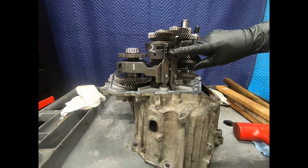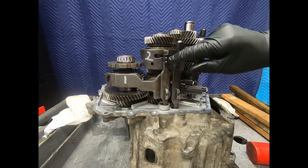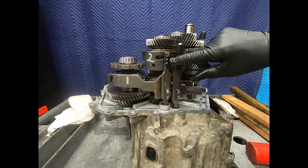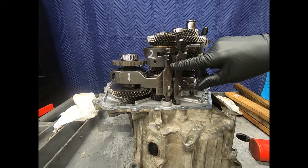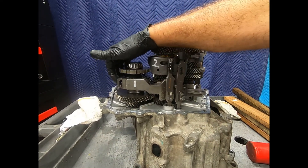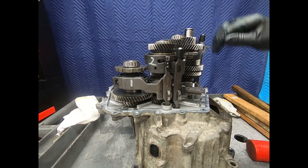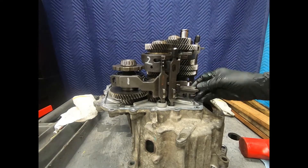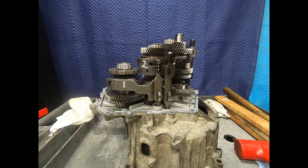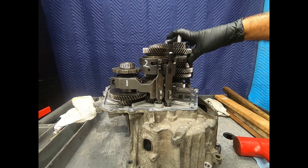...this ball bearing type of bushing for the reverse shift rail. This has a tendency to break up — we showed this earlier. We've got a brand new one in there. These are just plastic bushings. Also, the plastic bushings that ride in the synchronizer hubs have a tendency to wear too. A remanufactured set of shift forks can be purchased — I'm talking about Asia and Europe, as Volkswagen in this country services their transmission as an assembly.